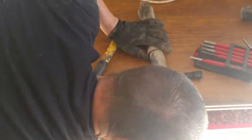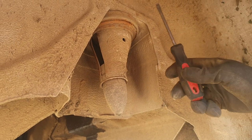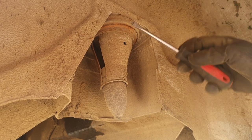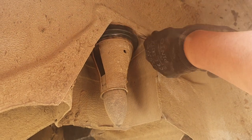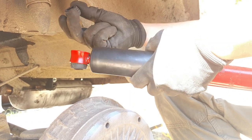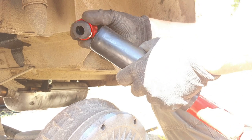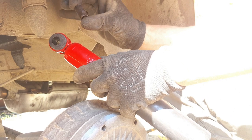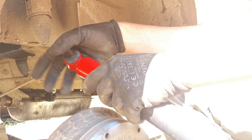And that's it - now we have everything. I forgot to take out this plastic that sits on the spring, so just use a flat screwdriver and pry it out. Now we put the new bushes in for the upper mounting point, and for the lower we need to reuse this old metal piece - just squeeze it in and then we are ready for installing.